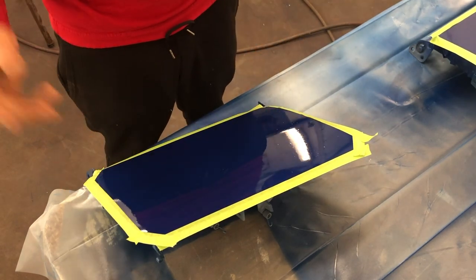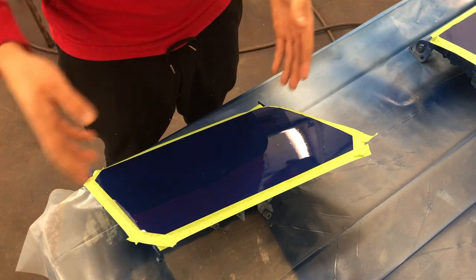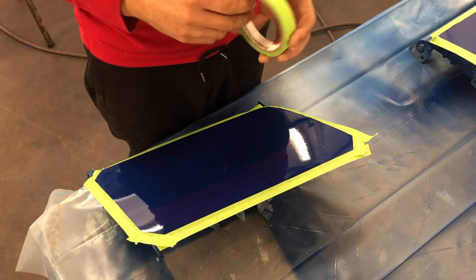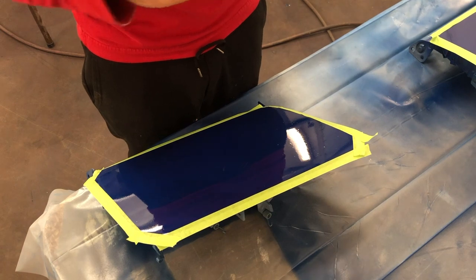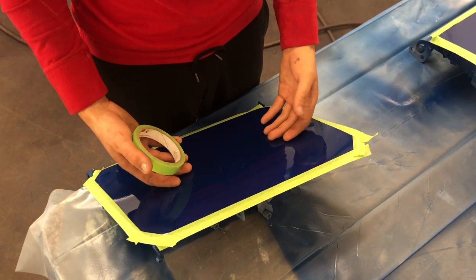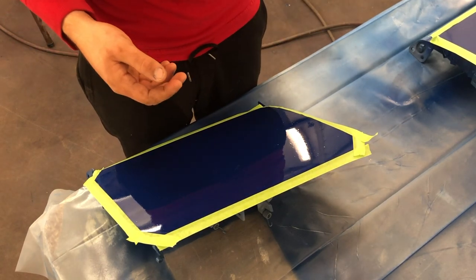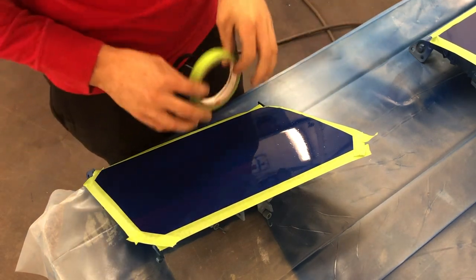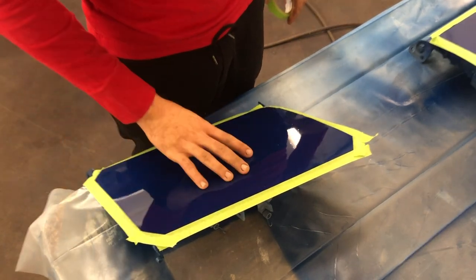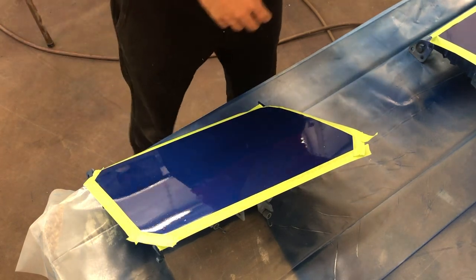Another thing, especially on fresh paint — you don't want to use regular masking tape or blue painter's tape. You want to go spend the money. It comes in all different sizes. I know we use green, and they make it in yellow, but this is 3M automotive tape. It's specifically designed to go on automotive paint finishes and come off without peeling paint or leaving sticky residue. This is a must with a fresh paint job. You will never see us putting anything but this on freshly painted vehicles. With that said, I'm going to start the process of sanding. Keep it wet with water and use a block.